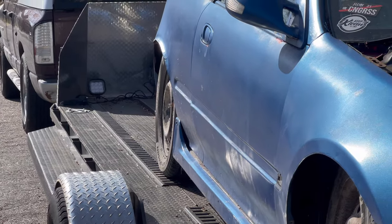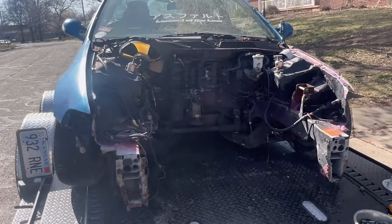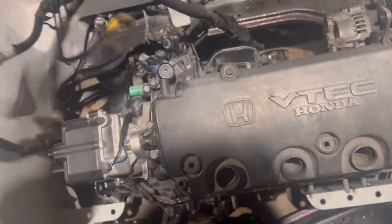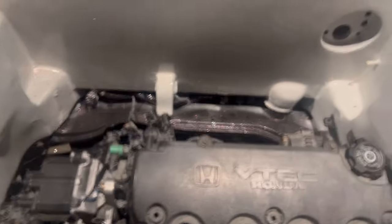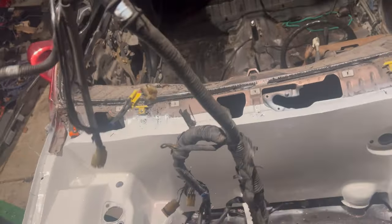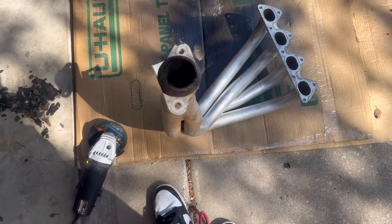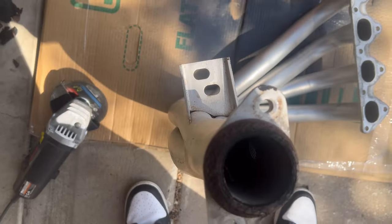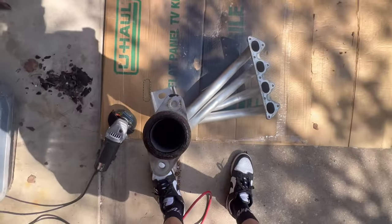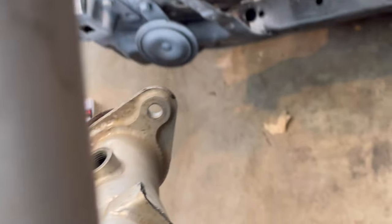It's still a little off camber but we'll get it adjusted. I need to get the tie rods changed so I can steer this thing. I figured out I really won't have to extend my harness all that much - my injector wires are already extended. Might have to extend a little more. All I have to do is run the two wires I plugged into the harness and hide everything else underneath the intake manifold and clean up the wire. Today I'm gonna be cutting on some stuff - cutting off this bracket right now to get it to fit. It ain't the prettiest but you ain't gonna be seeing it.